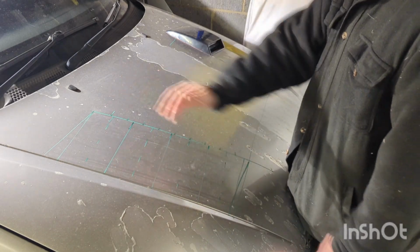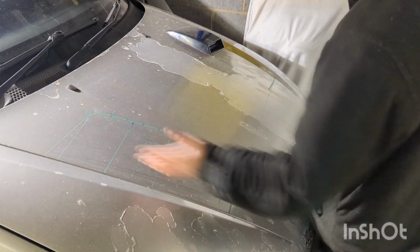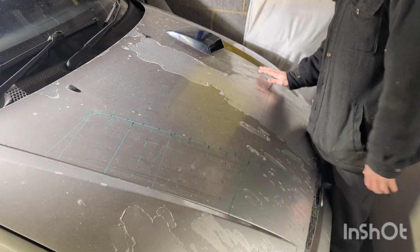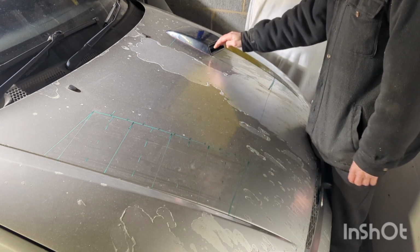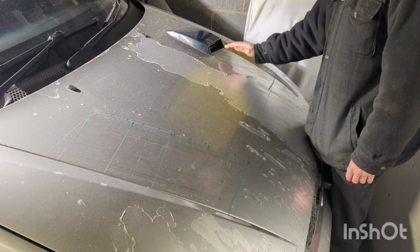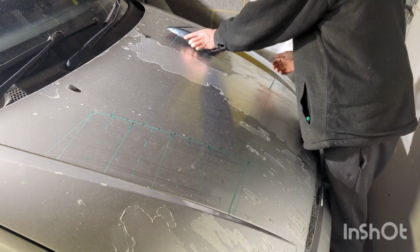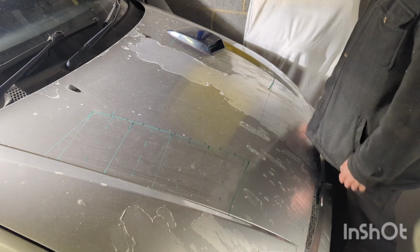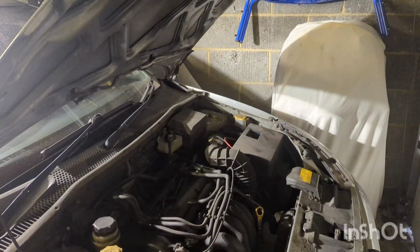That should be every 6 centimetres and give us 4 slats that all run up, follow roughly this shape at least. And on this side we're going to take this section of that, go in, so cut there, cut across the back up there and bend that in, and then this bit will be fully removed under the scoop, and that will sit there. And yeah, time to cut some metal. Let's see how we end up.